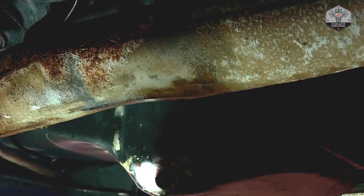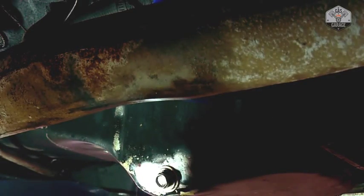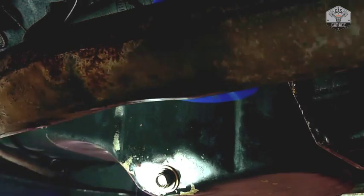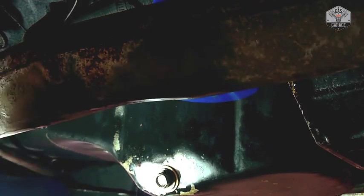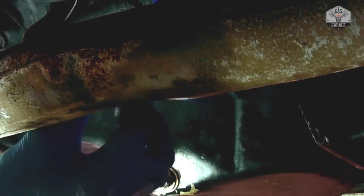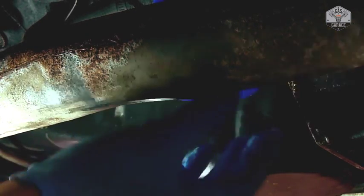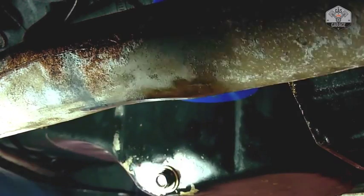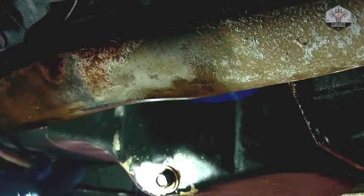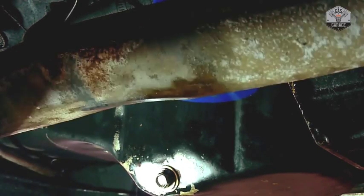And what you're going to do is unscrew the filter, drop some of that oil into the drain pan, okay, leave the filter upside down, grab the new filter, get a little bit of clean oil, and with a finger, go around the rim of the new oil filter in the gasket, and then you're just going to pop it right in, and screw it right back in again, finger tight. It doesn't have to be crazy tight, and then you're off. Then you're just going to go back up on top to the valve cover, pour your new oil in, and you're good to go.